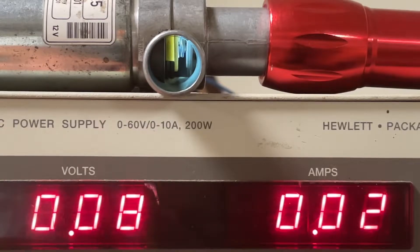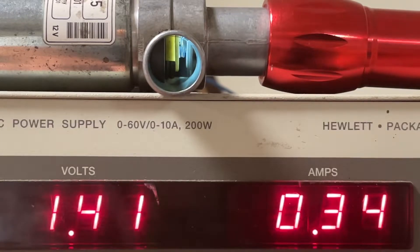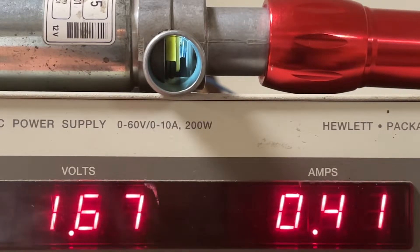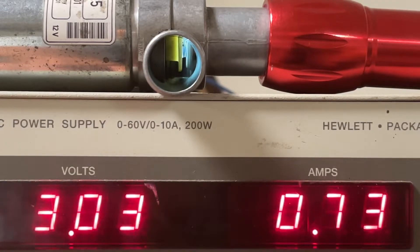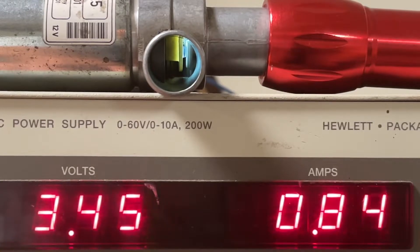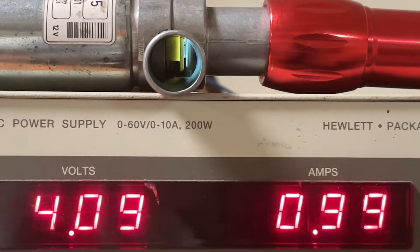Here's what I'm going to show you, and this is where the problem is: some of these units will not work. You can see we're bringing the voltage up — we're now at 340 milliamps, 350 milliamps — and you can see our little hub is moving closer and closer. If you've hooked this up to your car, you know that your control unit will stop at 990 milliamps, and what do you see? We're at 4 volts and we still have a gap.